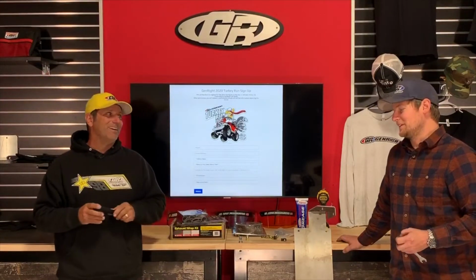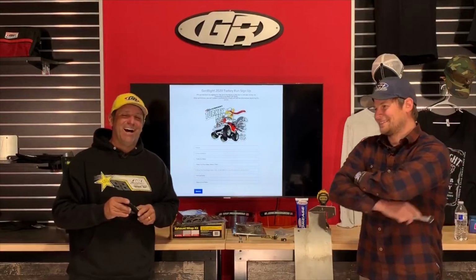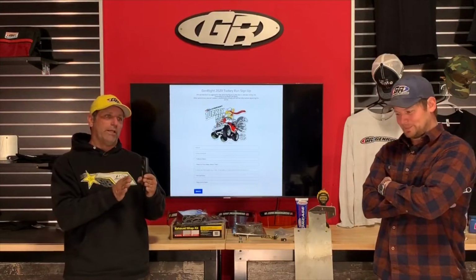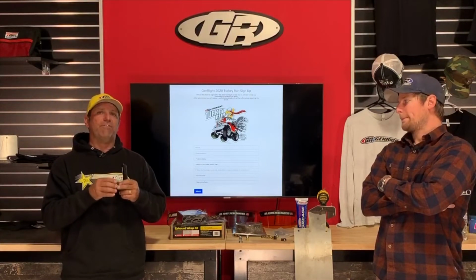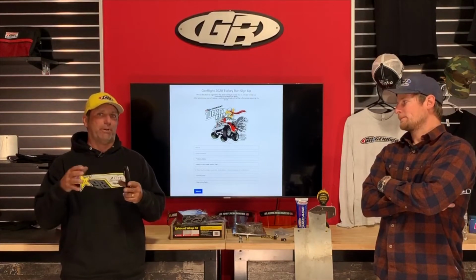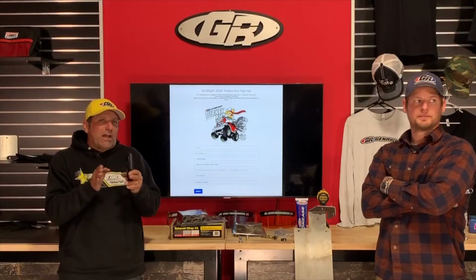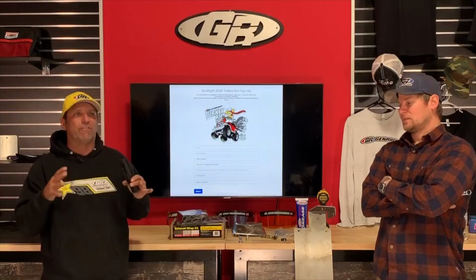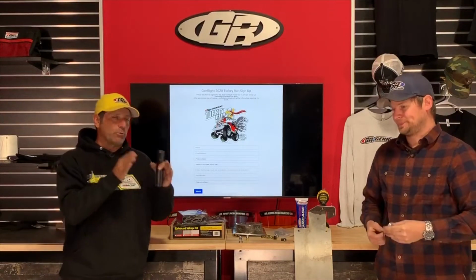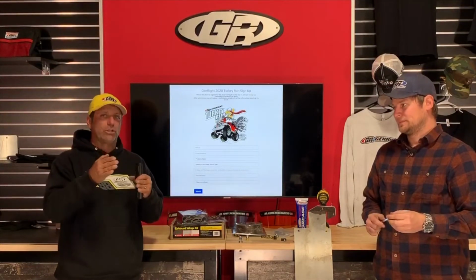and Jeff's had a lot of experience with this since he got here. Yes, a lot. And just to give you an idea, I'm running a 3.0, which if you do the math is a 65% increase in dampening control. I know it doesn't sound like much. You go, well, that's only another 1/2 inch, but it's a huge difference in dampening. So from 2.0 to 2.5, huge difference.